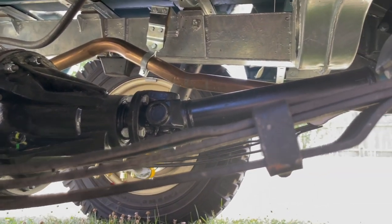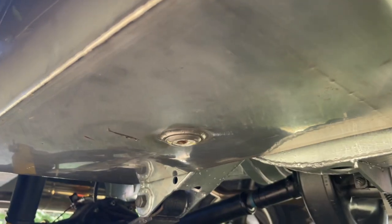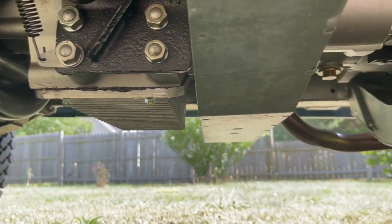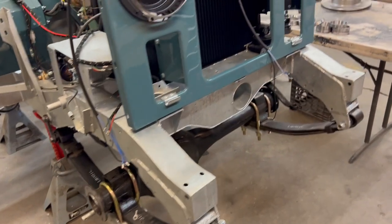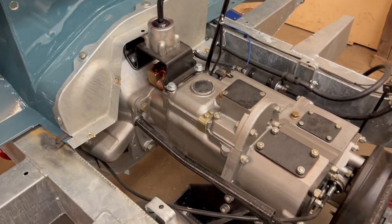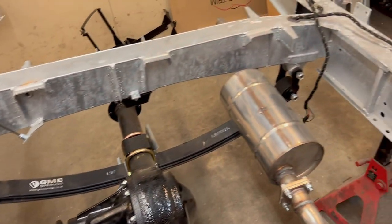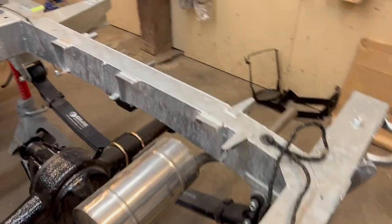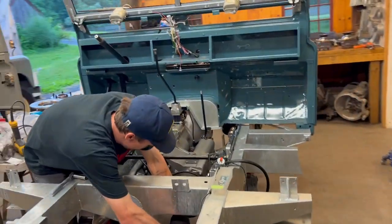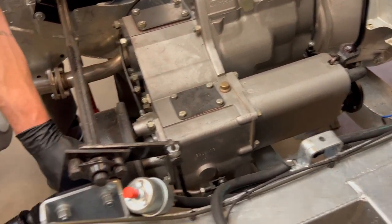Another one of our goals is rust resistance. With our full galvanizing package, everything steel under the vehicle that can be galvanized is galvanized. It also has stainless steel components like a stainless steel gas tank and exhaust system. Every one of our vehicles gets a new frame — not because the frame design was bad; it was actually a very strong, light box design. But when salt and mud get inside the frame, they rot it from the inside out. Even from a dry climate, the fairly thin gauge metal develops cracks and metal fatigue, so we just start with a new frame on every build.